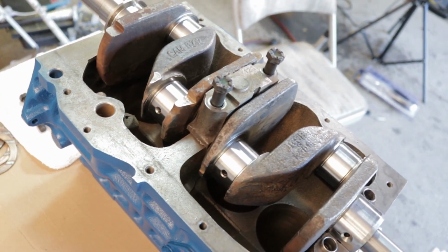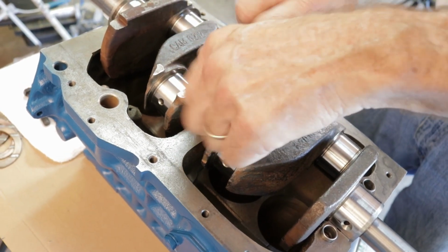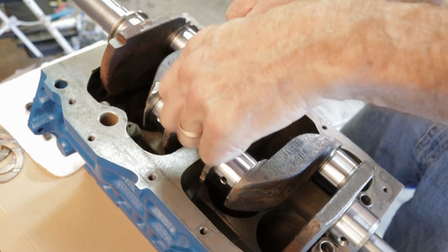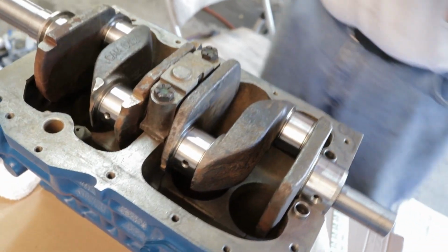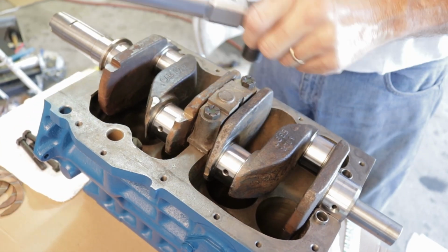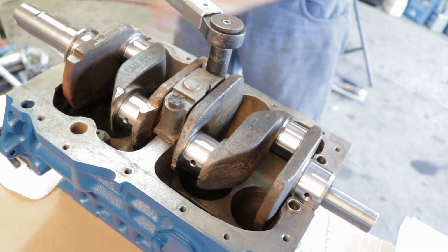No, actually I'm not going to oil. You're talking about the threads? Yeah, I'm going to use, I think, red Loctite later. But this is just a test fit, just to make sure the clearances are good. And so you're torquing them down to the specified torque. Right. I have 85 newton meters according to the book.